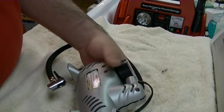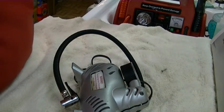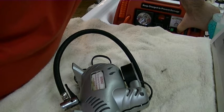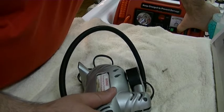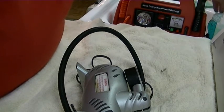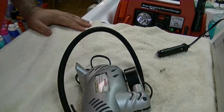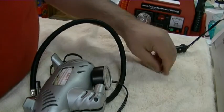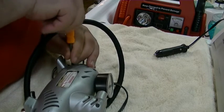Now we just put her back together. As far as it actually working, I guess I'll have to wait till I get a low tire. It's obviously running kind of slow because I just have it off the little jump pack which probably needs to be charged. It's reading at the bottom end of green. This pack needs to be charged but it does run now and it makes air. So I'm going to go ahead and tighten up the head bolts a little bit more just to make sure, close her up, and that's going to do it. Cool — we saved one. Even though it's made in China, sometimes you can get away with fixing stuff. Awesome. Anyway, thank you so much for watching, make sure you click like, and take care — we'll see you next time, bye bye.